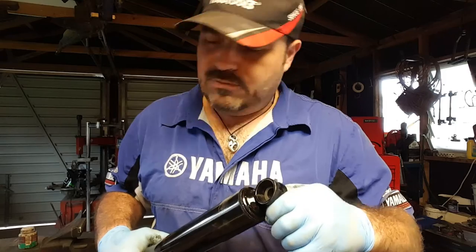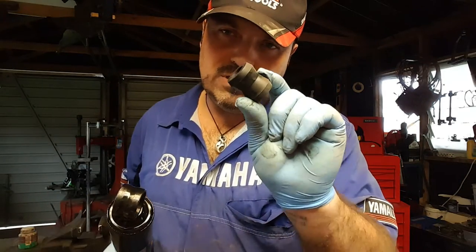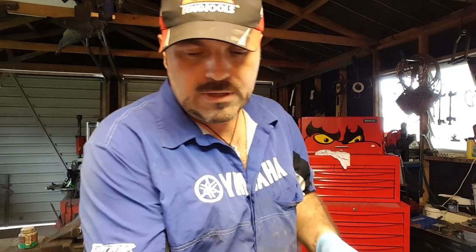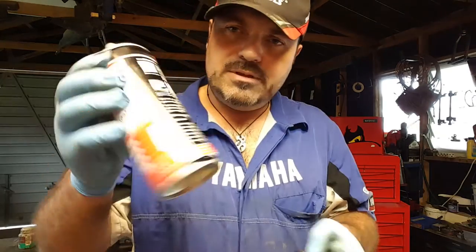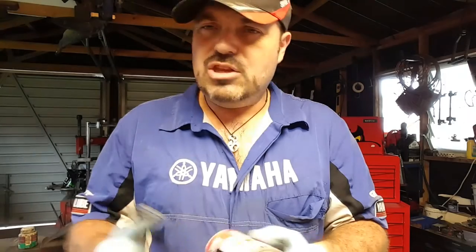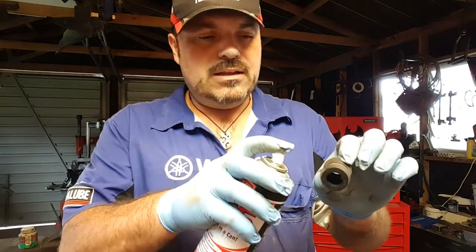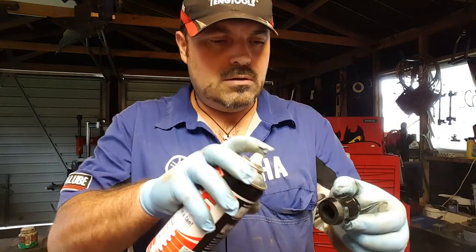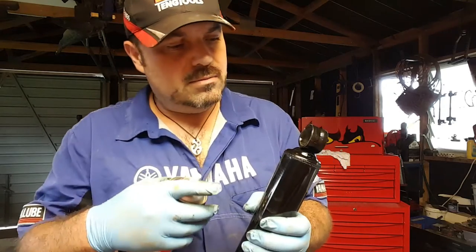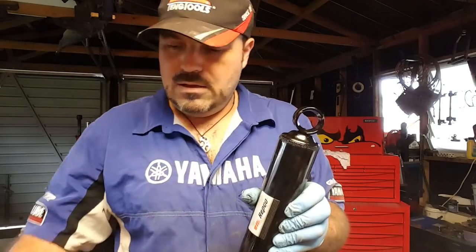So I'm going to show you how to fit one of these style bushes, and there's a trick to it, and we're going to use the vise. So your first job is get a little bit of CRC spray. No, I'm not sponsored by them. You can use WD-40 if you haven't got either. Use a bit of engine oil, it doesn't matter. And we're just going to put a little bit around the bush. That's going to help it to go into the body of the shock, and we'll do the same on the eye.